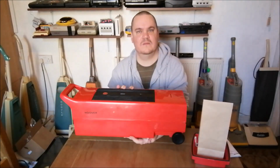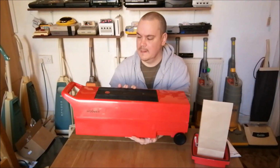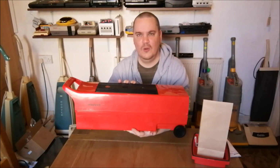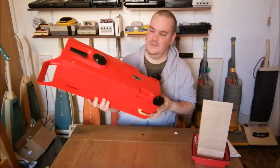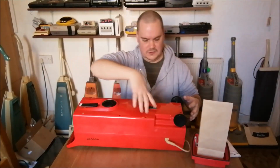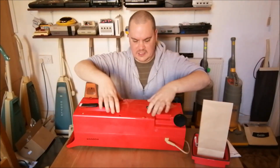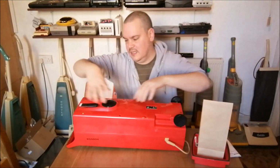Anybody who's seen the Secret Life of Machines vacuum cleaner video will note that Tim Hunkin had a Freedom to do his experiments with, and when he took it apart, he took the bottom off. So you have to, pardon the expression, go in from the bottom, undo all of these screws, and then you pull the lower section up, and that exposes the motor here. And then if we had a flex winder, the flex winder mechanism would be here. You've got the bag chamber.